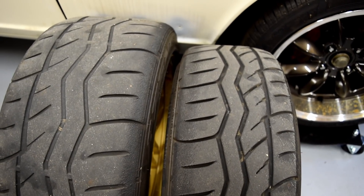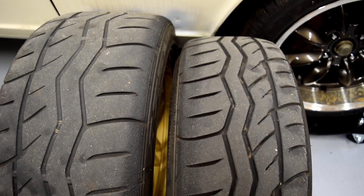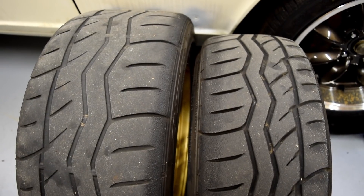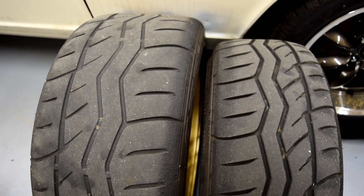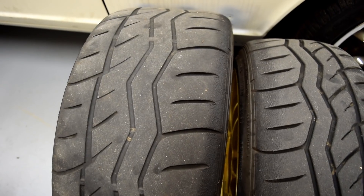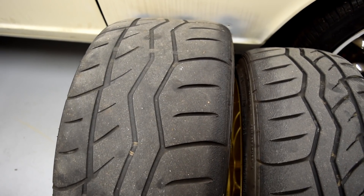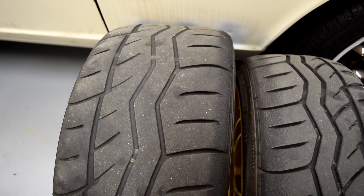I may need to look at doing some tweaks to how I've got the camber done. I've been having a sort of a silent debate about my sway bar setup on the car, but given that I've gone from a compound tire back to a street tire, really I have no complaints. These things did great on the way to and from California. They are still not noisy. We drove through a little spot of rain on the way home, and in spite of this being down to like two or three thirty-seconds in a few places, we still did not really encounter any hydroplaning situations. I'd be hesitant to do that at this level of wear, but for dry weather or just a damp road, I think they'd be fine.